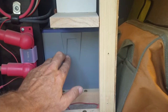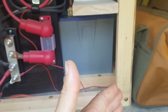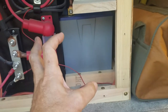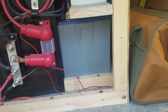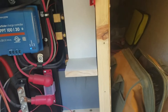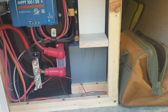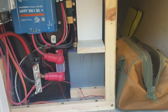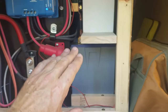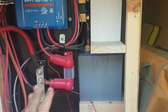In here is also the lithium battery, which is a 100 amp lithium battery. Going from a deep cycle 100 amp battery which has about 50 amps of usable service life, a 100 amp lithium battery gives you a full 100 amps. I've blocked it in here pretty tightly so that it won't vibrate. The original batteries come on the hitch of a trailer, but because of the cost of these batteries as well as their temperature sensitivity, I've placed them inside this compartment to keep the temperature stable, to keep thieves away, and to make the cable lengths as short as possible, which improves overall efficiency.